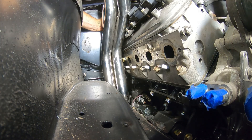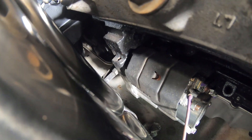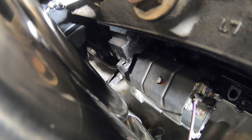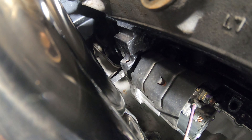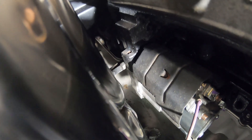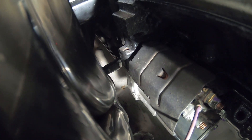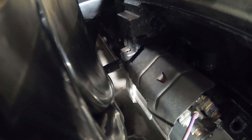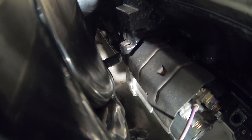It's hitting exactly where I was expecting. I do have a 4L80 in this thing, and that little tab sticking off the side for the scatter shield bolt is jammed up on it. Now, Speed Engineering did say if you're running a 4L80 you might need to make some cutting modifications — didn't specify that piece exactly, but I assumed you'd have to do some cutting to make these headers work.